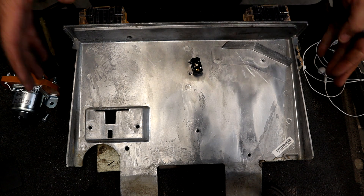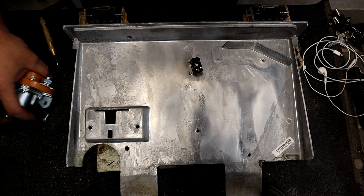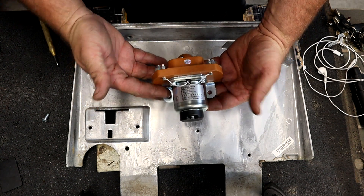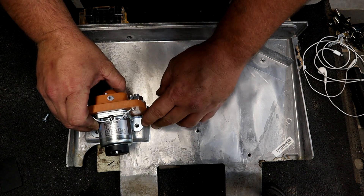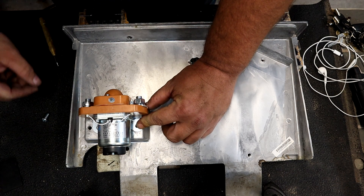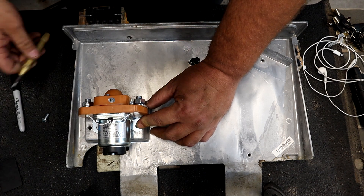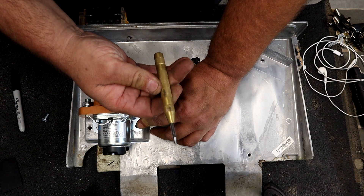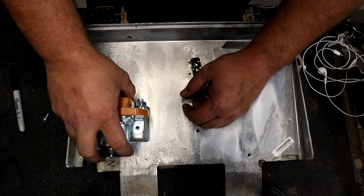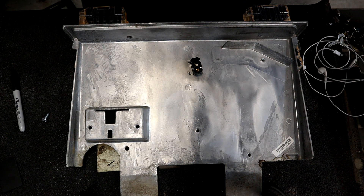We went ahead and took the plate out of our cart. I left the run-tow switch right where I said I was going to — to make it easier to show you guys. We've got to mount the big MZJ 400 solenoid. I'm going to use an existing bolt hole for one side, but on the other side we don't line up. You can use a sharpie to mark your spot — I like to use a spring-loaded punch, make my mark, and then drill another hole. Before we do that, I'm going to make this hole a little bit bigger so we can put a quarter-twenty screw in there to hold it all together and get an accurate mark.